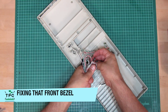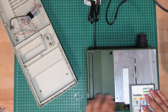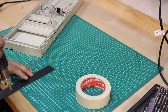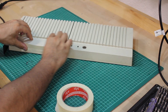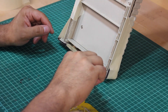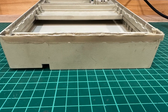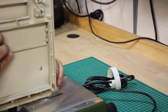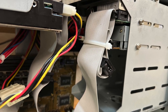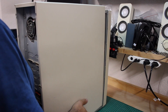Back to crafting — I need to care for that broken-off piece of plastic on the front bezel. I'll use some foam plastic to fabricate a minimalistic mold, temporarily affixed to the bezel using paper tape, then use a fiber plastics compound to fill up the missing part from the inside. Once dried, I remove the mold. The insert doesn't look too nice yet — it needs some polishing and I need to cut some excess material in a straight line. Eventually, with everything fixed up, mounted, and the cables neatly stowed away, the case can be finally closed again.